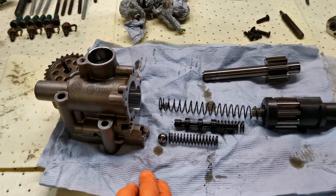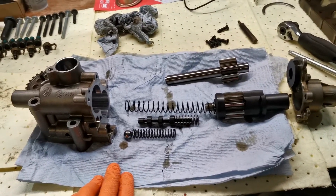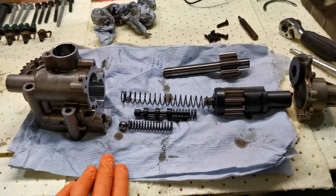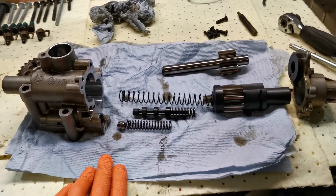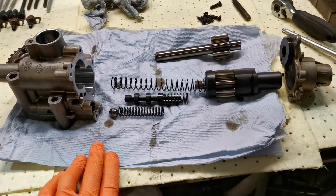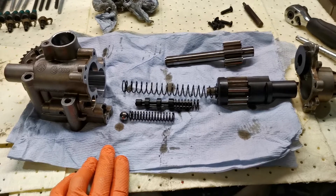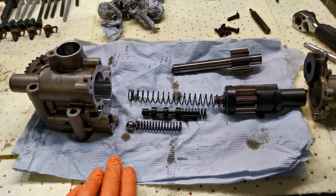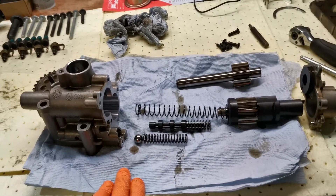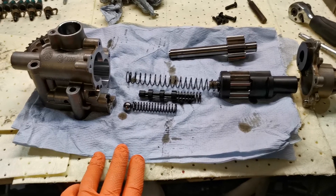It's actually quite a simple bit of engineering. But the problem with the low and high pressure mode is when you have a hybrid turbo, or any high-performance turbo where spool is incredibly quick, you're going to have a tremendous amount of load on your bearing shells — your crankshaft bearing shells, big ends and mains. Because your oil pump is still in low pressure mode, you have a lot of torque beating on those bearing shells, really squeezing the oil out of them, which is going to start to hurt them. So what I've done is disconnected the oil control solenoid on the block, so the oil pump will always operate in high pressure mode — maximum oil pressure at any given time.